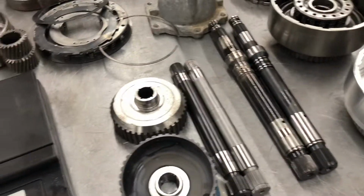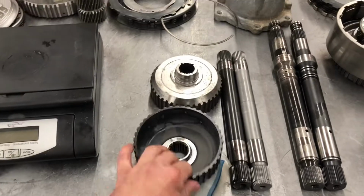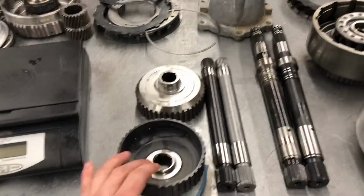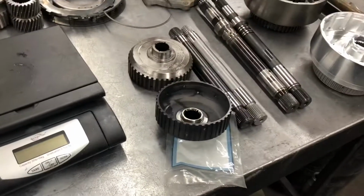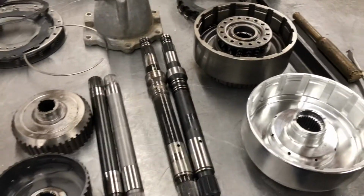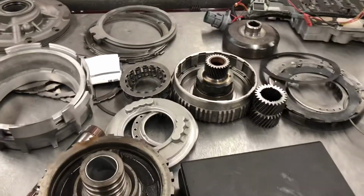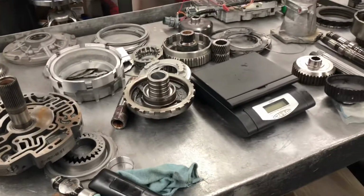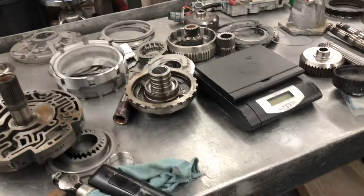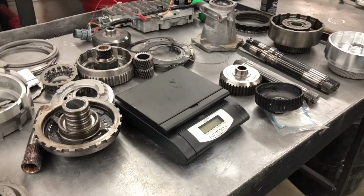So yeah, I've seen this in my personal transmission. I've been 8s with just a billet input shaft and the cone version of this billet forward hub. So 1,000 horsepower in a 4,000 pound car. This stuff should go all the way to the point that it blows up the overdrive assembly. That's the weak link in these 4L80s. That's usually the first thing to go once you put all this stuff in.